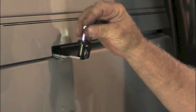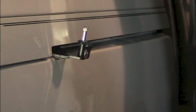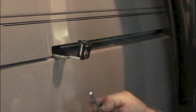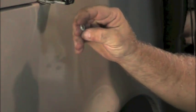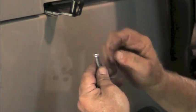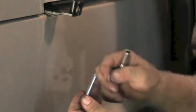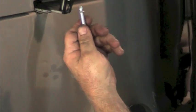Now we're going to have to put this pin back in once we put the door on and drive it down. We need a keeper on the bottom. A lot of times when you pull these out the first time, the keeper will just break and fly away — it should look like that. You can go to the parts store and get one if yours is broken, just get assorted little keepers. If you take a socket that will slide over the pin, you can push that keeper on and it'll hold.